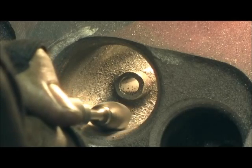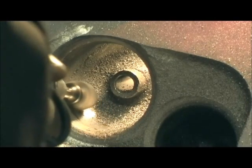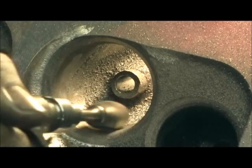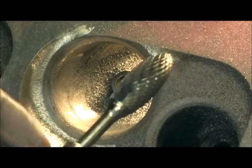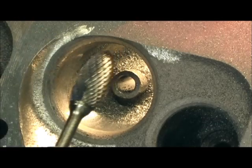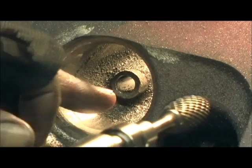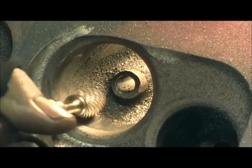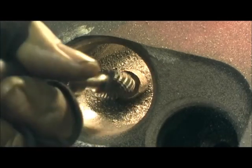See how slow I'm going? I'm just pulling it, letting it dig. What this does that makes it so awesome for this particular bowl is the taper - notice how you've got the belly sticking out and then coming back. When you lay it perfectly straight and let it rest on the highest part - which is the last angle where it goes into the bowl where the factory cut is - and you put that down, it's already forming a perfectly round bowl. You're applying pressure in a straightforward manner; you're not putting it down there.